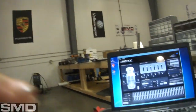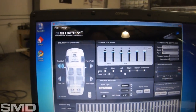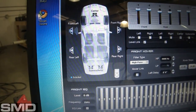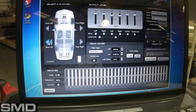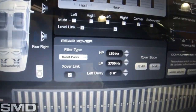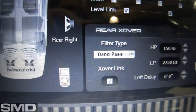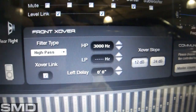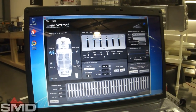Now that I'm getting in here I can see what I actually did when I first set this up. The first processor is named 'Tweet and Fours' because 360.2 number one operates my tweeters and four-inch mids. The fours are bandpassed — picking up at 150 Hz and dropping back off at 2,750 Hz. The tweets are 3,000 Hz and up.